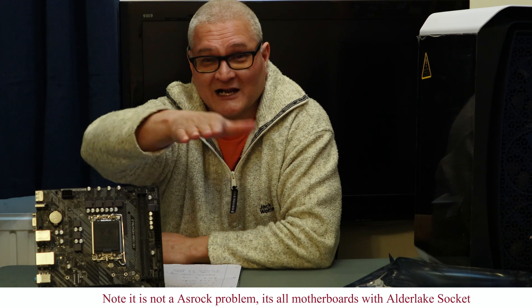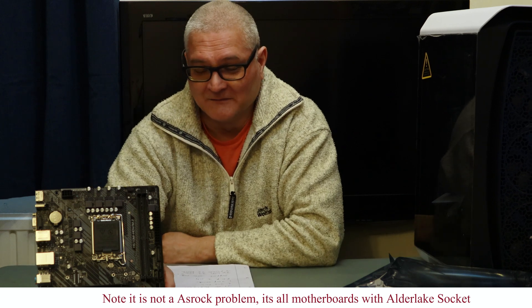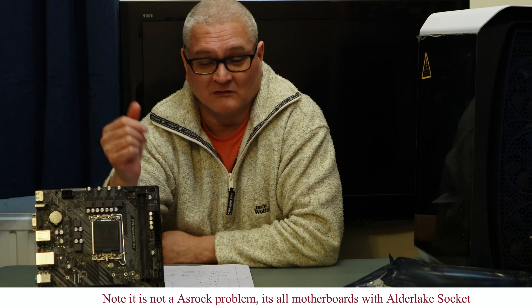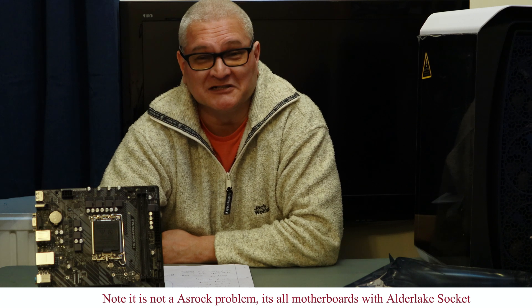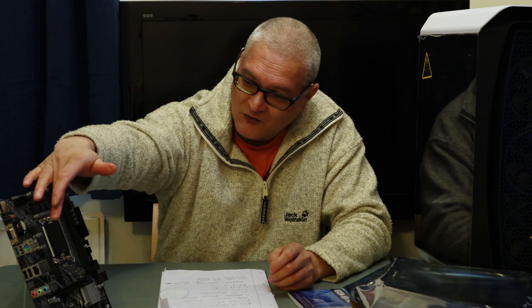When the CPU bends out of shape, your cooler doesn't sit flat so temperatures go up. Hopefully Intel will fix that and it may be a rare occurrence. The board itself is black with gray stripes going across it and gray writing, which I find quite hard to read — but I'm getting old. It is a six-phase power design. There are no heatsinks on the chipset or VRMs at all, so we'll see how hot it gets.